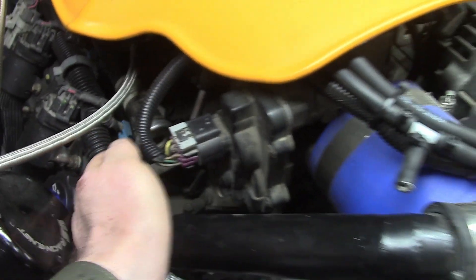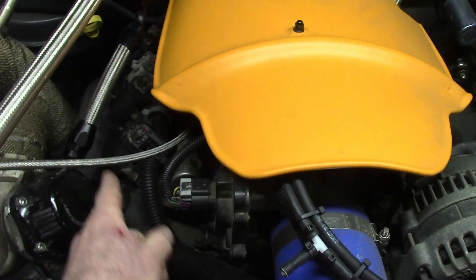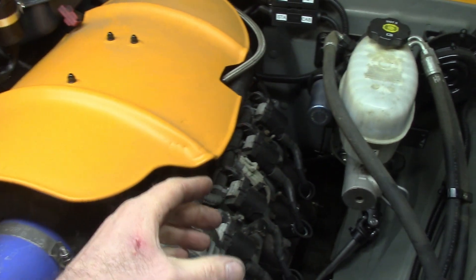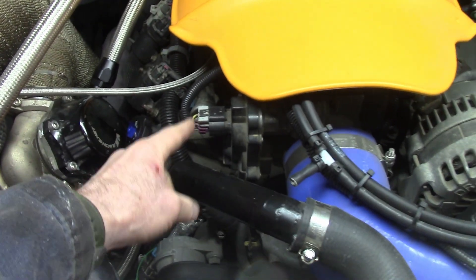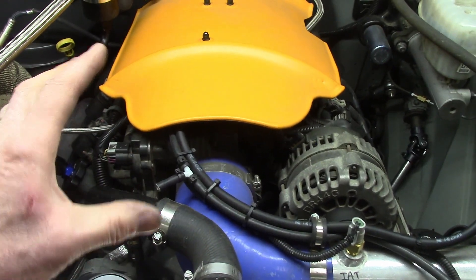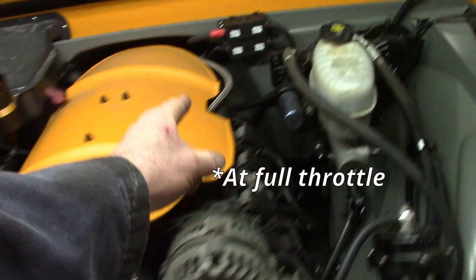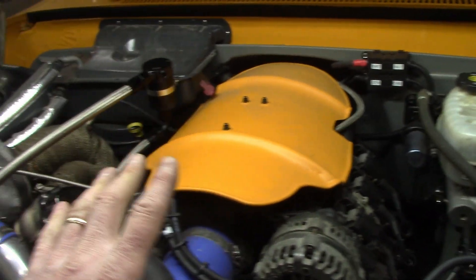So this should go to this side of the throttle plate. Fresh filtered air comes in, goes through that little hose into that valve cover, goes past the rings, picks up all the schmoo, and gets sucked into the intake manifold back there. Under full throttle, there's no vacuum sucking that in, but under full throttle you're probably going to have a whole bunch of stuff going past the rings anyway. So instead of pressurizing the crankcase, it comes through that little hose and goes into the airstream and gets sucked into the motor and burnt. Some folks put a catch can in that system, and in theory you probably should have the catch can on this side catching the debris going into the airstream. I probably wouldn't put one over on that side because when you're cruising, it really doesn't matter.